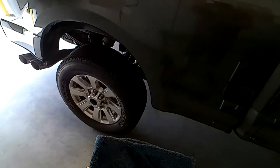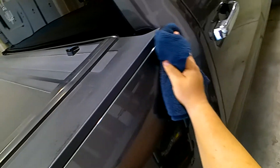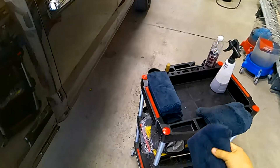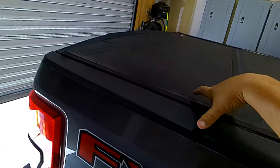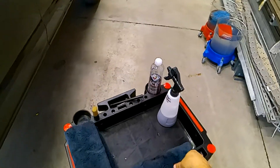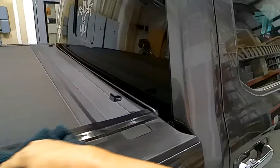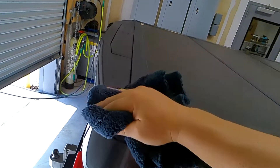That is the only time I will use this side of this towel on this truck — at least on the paint. I won't come back and put any other section of paint with that used portion of towel. Now that I've done the initial wipe-off, whenever we're done with this section I will spray a little bit of CS3 into the towel and come back along this section to clean up the trim. We'll use that same section of the towel — but I promised I wouldn't use it on paint. We're just using it on trim.